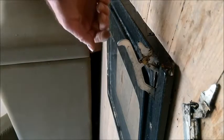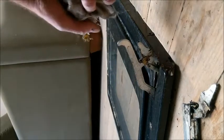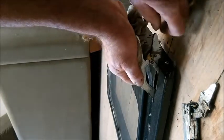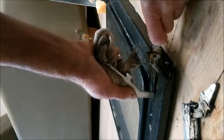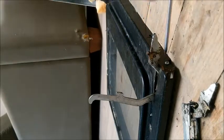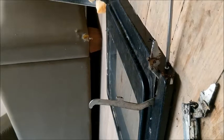The next thing we need to do is release the tension on that spring. Using a pair of gloves or a rag, push down as hard as you can, then flip that clip over, release the tension of that hinge, and now remove the two screws holding the hinge in.